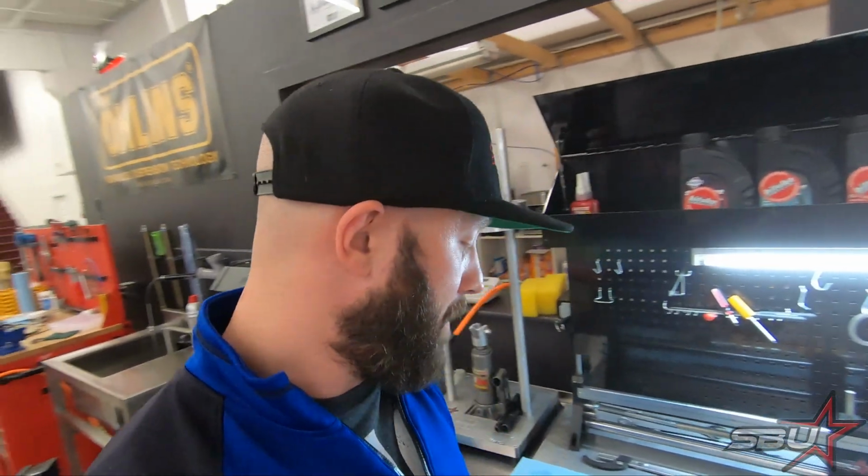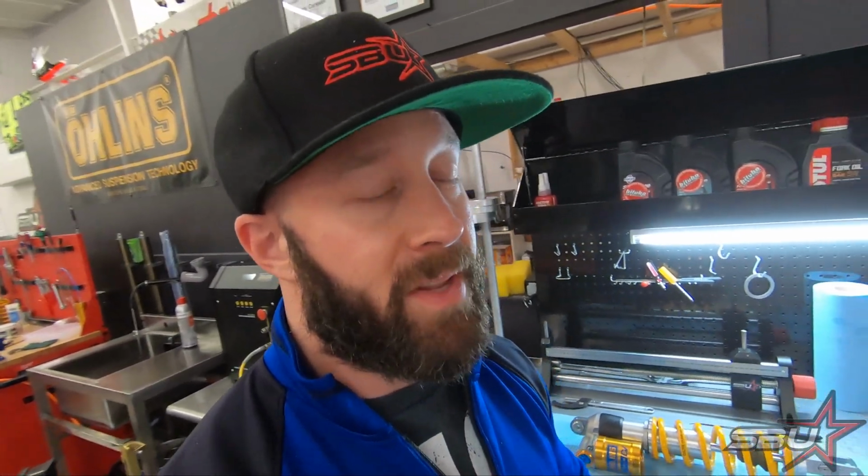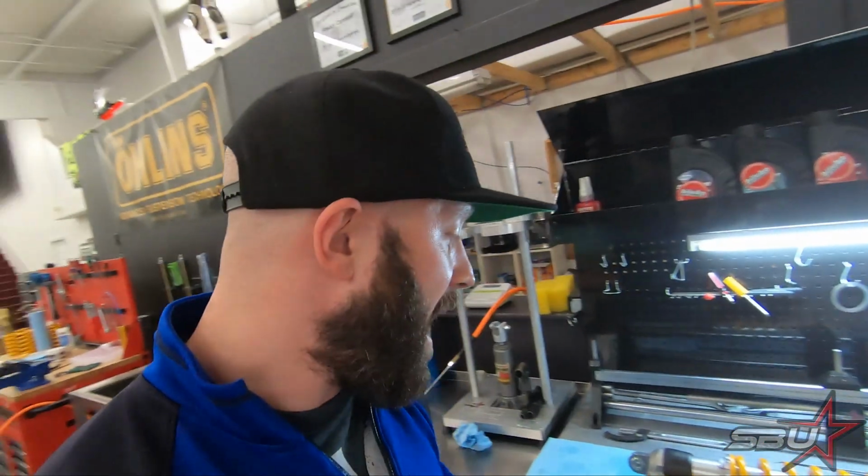And what we were told is that basically having this right in the middle, say if you're at that C5 setting, you can open it all the way, which is going to be counterclockwise, and that would be the equivalent of say a C4 setting. Or you can close it all the way, and that would be the equivalent of say a C6 setting. So that's pretty badass, because now we have this higher level of adjustment and ease of use.